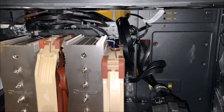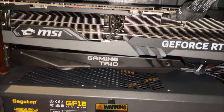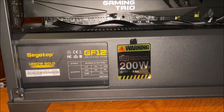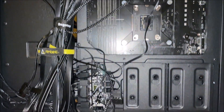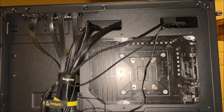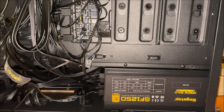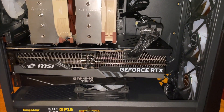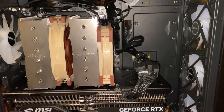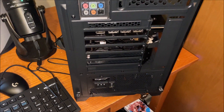You want to make sure you have all the connections on the bottom of the motherboard done before you put in everything. That was a mistake I made and I had to go back — it was a bit of trouble. You can see how the bracket kind of sags. We ended up putting a fan underneath there just to prevent the sag. There's also a $10 pillar I bought later that is made for cases and has a magnet on the bottom just to give it more support. You can see how the fan is kind of holding it up and gives it a little bit more airflow.